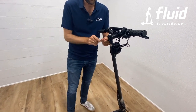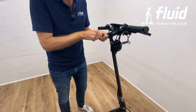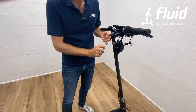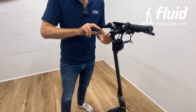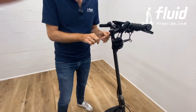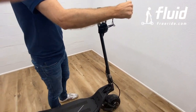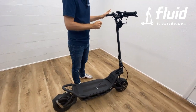And the same thing we want to do on the bottom one right here, where you push it down a little more until, with a finger or so, you can't really do it much more. And like that, you feel this, you can move it back and forth, left and right, nothing wobbles, everything seems to be good. Now, that should be roughly around 5 Newton meters.